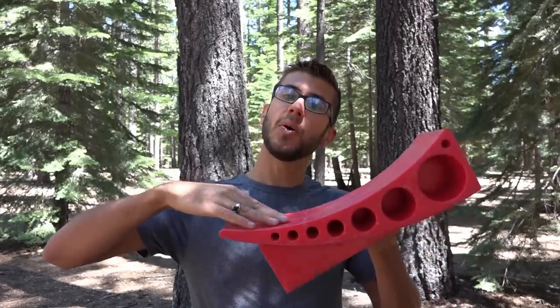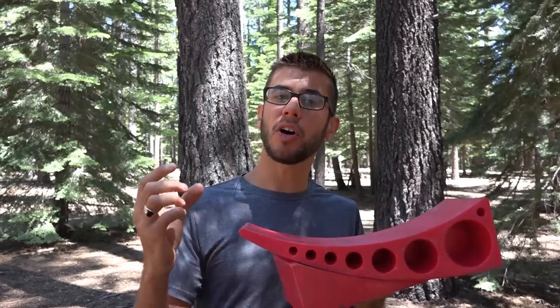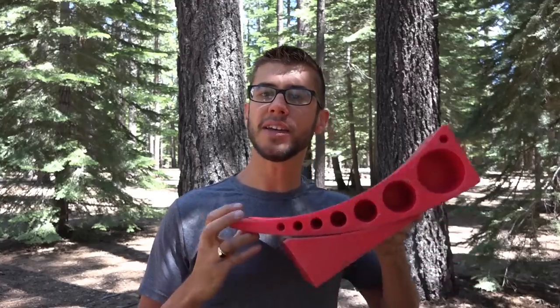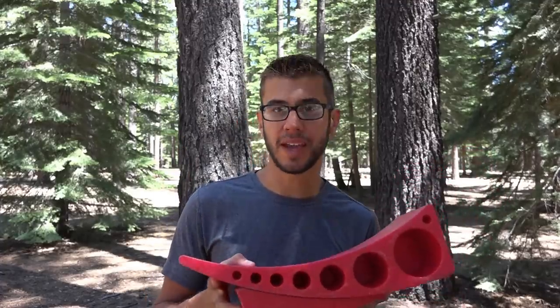These work with tires up to 31 inches in size, as they need to be able to fit within the curve. For a multi-axle trailer, you need to get one of these levelers between the tires to drive up onto it. If your tires are two to three inches apart at the closest point you should be able to fit them, but if not, you can cut off the nose section — the section without the holes — to shorten them and still use them with your camper.